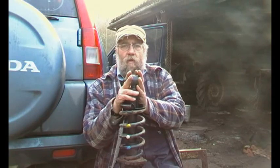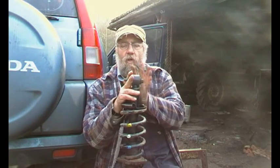So I had a word with my neighbour and went round there, put it on his vehicle lift and heated the nut up to the point where the bolt would move. Yeah? But of course the big bush in the middle of this rubber, which we'll have a look at shortly, it started turning in the rubber. So what we've got to do at some point, and we'll have a look at the offending article, is use a fine narrow angle grinder and cut the bolt either side.